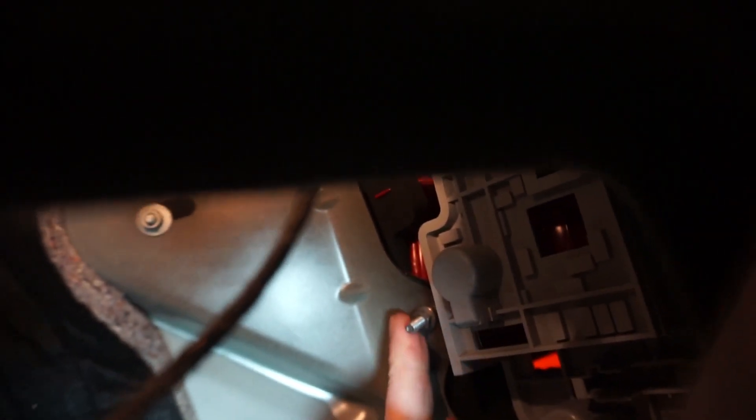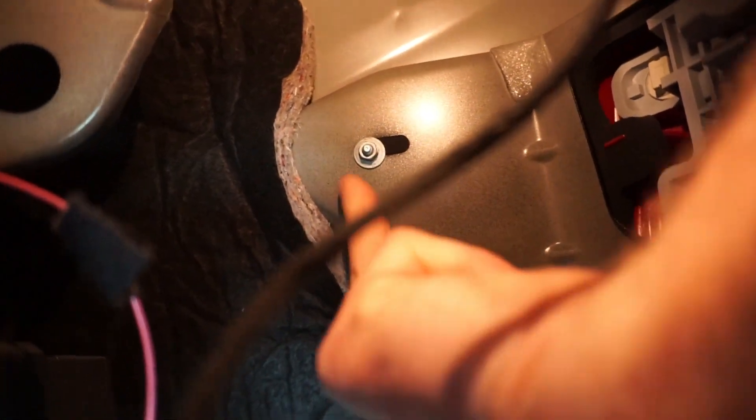To get to these tail lights, luckily on this side I've got a fuse panel here, and here's the lights. I unplugged this connector, and I'm going to take the bolts out — there's like four bolts, one there, one there. Let me pull this clip off. There's a couple bolts there, and then I'll be able to pull out this whole light assembly.